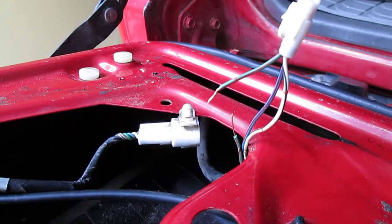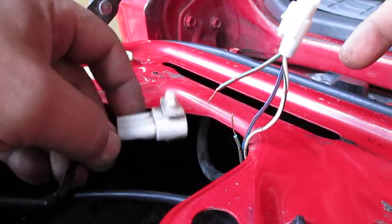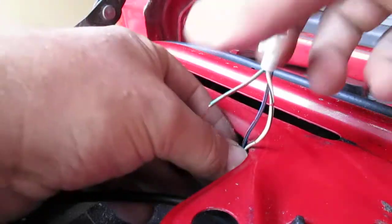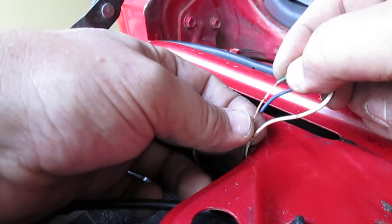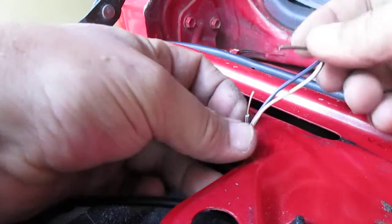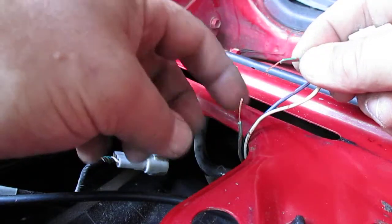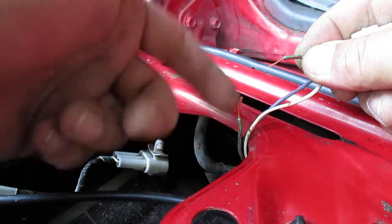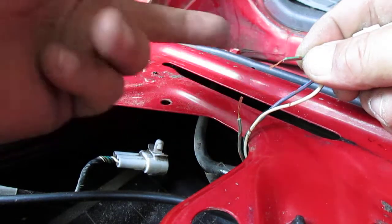And always remember, when you're working with the electrical stuff, which I'm not totally new to, but I'm just kind of relearning it since high school, before you cut a big section out, I just cut a section here. This is exactly the length of the wire, see, and then stripped it on either end, so that I have room to wrap this around the diode, and then wrap the wire around that before the negative side of the diode, so that I have wire to play with.